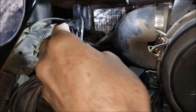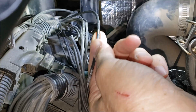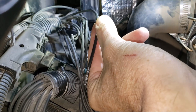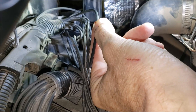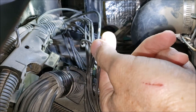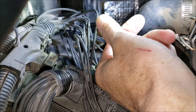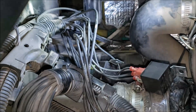While changing this, I did notice something — check out this one little wire. See how it's worn? You can see the wear down to the white insulation. It's not down to the copper wire itself, but in just eight years it's taken quite a bit of wear. There's a real possibility that with all these wires and the way generators shake and vibrate, if one of those lands on a sharp piece of metal, it wouldn't take long to rub down and cause a problem.